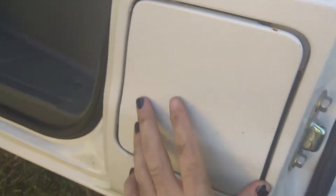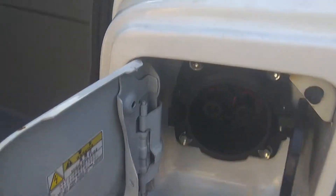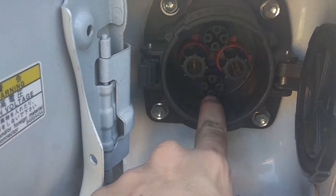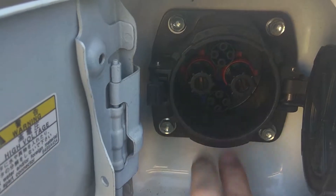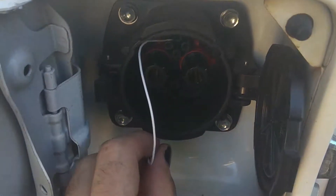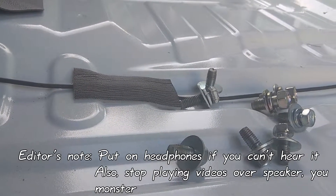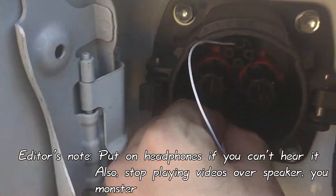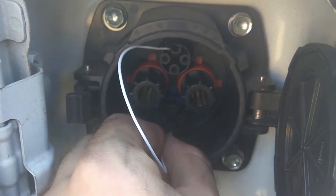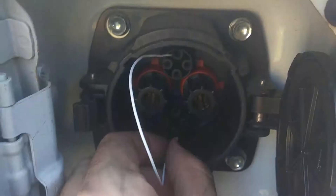With that connected, what you can now do is bridge pins three and ten. It's this top pin up here and this bottom pin down here, and that'll connect this to the main pack voltage. You can hear a little clunking going on in the car — that is the main contactor for the CHAdeMO port being connected to the battery. I'm going to go ahead and do that and then show you the actual voltage coming out of the pack.